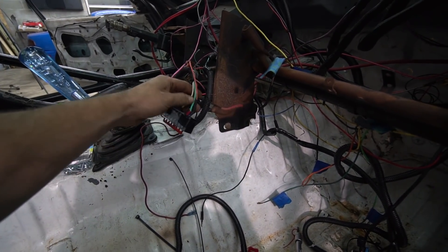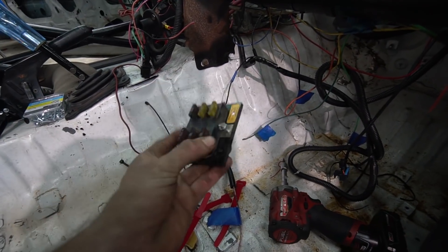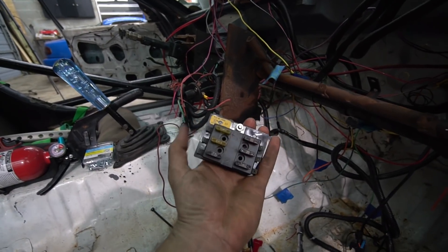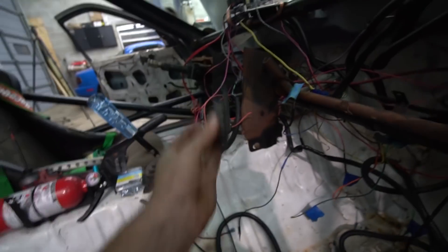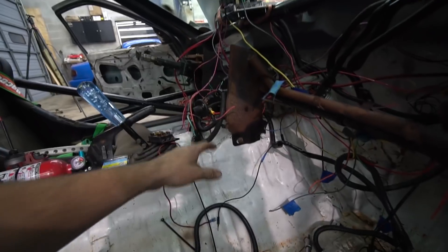Really the only thing on here that I'm using is the brake lights. So instead I'm going to replace it with this — we'll have power going to this which will click on when we click ignition, and basically it'll power up this whole little board with all these little spades for fuses, with fuses. So everything will be individually fused, so if something shorts out one, it's not going to take out everything on that circuit — which is a lot of stuff currently.